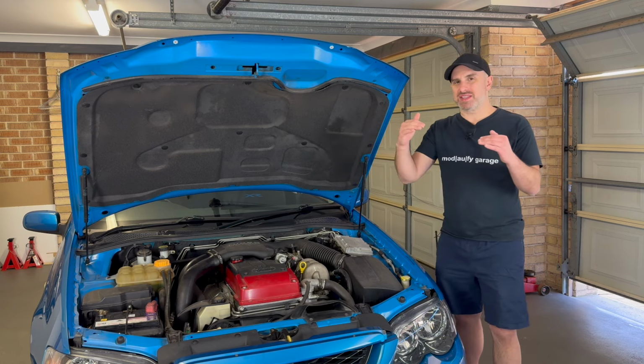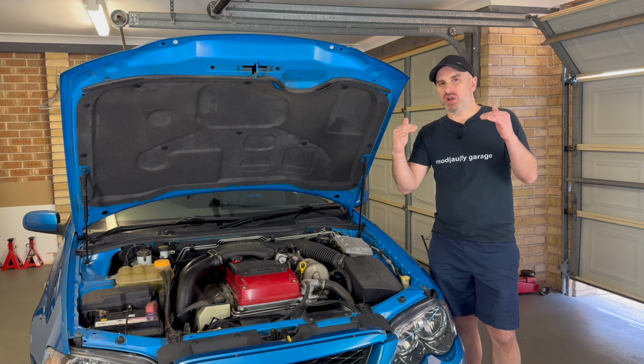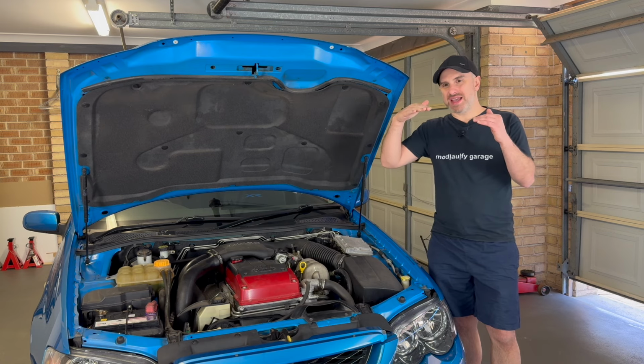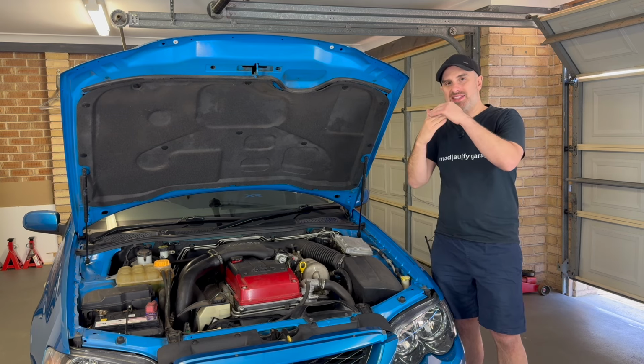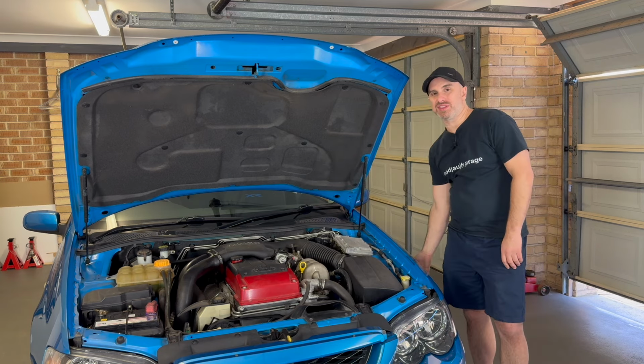And what I've noticed, there's a 5mm difference between one side of the car and the other. While it's not a great deal, the problem is when I'm driving over the roads and there's a slight undulation, the tire actually rubs against the guard. Now I've had the guards rolled as well, but it's not happening on this side.